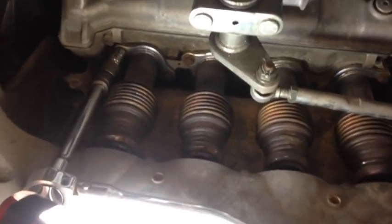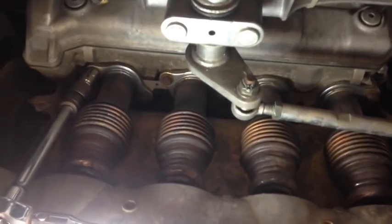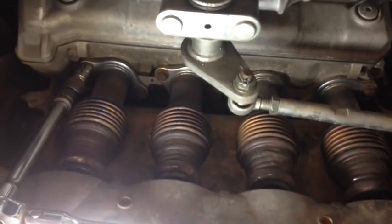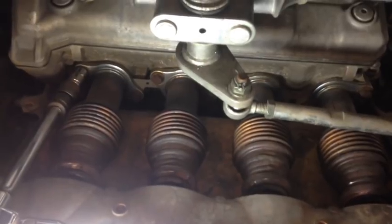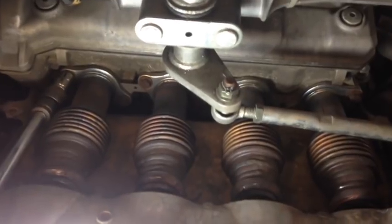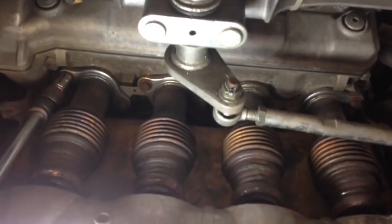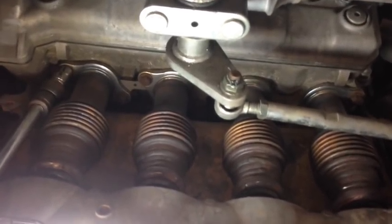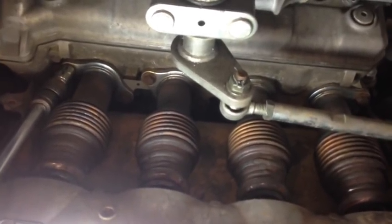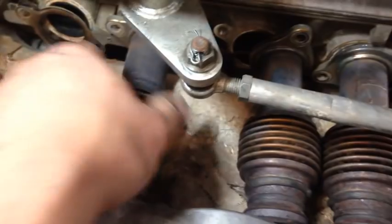Cracking your manifold bolts, head manifold bolts from the block. The biggest thing is to take your time, even pressure, and it will crack free. If you crank on the bolt, it will probably break. So don't crank on it, just even pressure and let it break free slow. If your heads get too rusty and they're rounded a bit, you can put on a 3/8 socket, hammer it on, and same thing, put a little heat to the block if you like, a little propane torch, warm up the block a bit. It also helps. Okay, I got all my bolts out. Pull our accordions out.